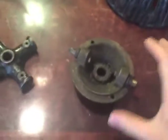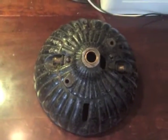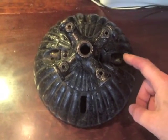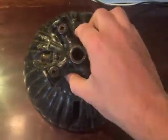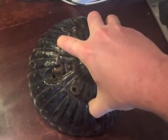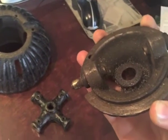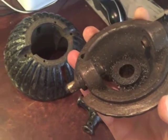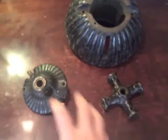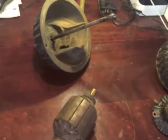Here's something neat. If the fan motor were hanging and you had the fan all together, you could cut the power, remove the motor leads from the motor coil, then unscrew the screws from this piece and literally drop the entire armature out of the motor in order to service the armature, service the brushes, and re-lubricate the bearing. There are no other DC motor ceiling fans I've ever seen that do that. I've seen my fair share of ceiling fan motors — that's just different. Some really cool, unique differences on this Lundell motor.